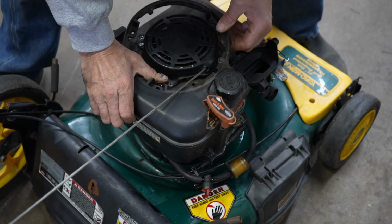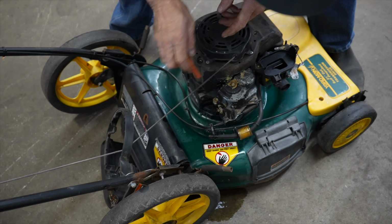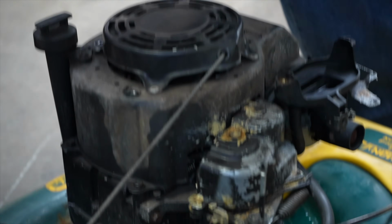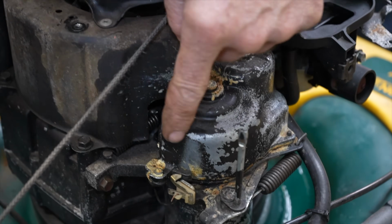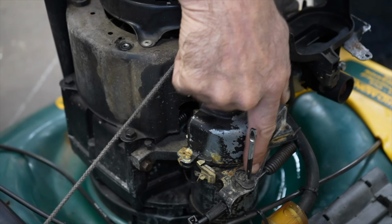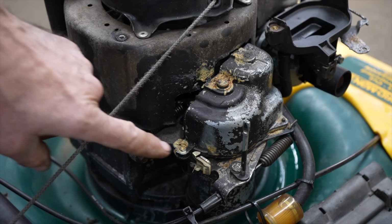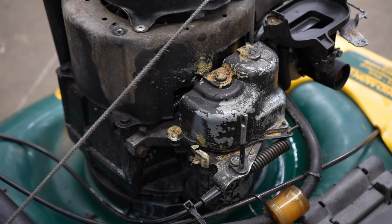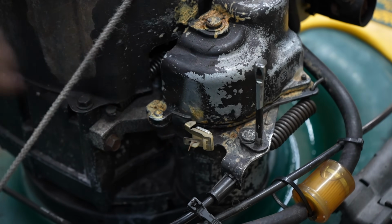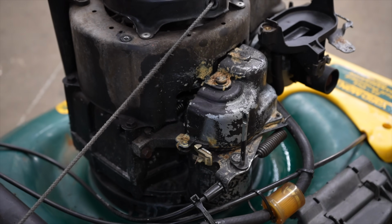Alright, I'm ready to remove the fuel tank and this little key, and it's got this little centering device which mounts underneath the tank. And here it is. It's just a spring-loaded starter. It's got all this safety mechanism, and then here's your kill for the engine. See, when I pull it back, it releases that brake. It gets away from the switch. And then when you let go of the bail, it kills the motor, engages that thing that rewinds it.